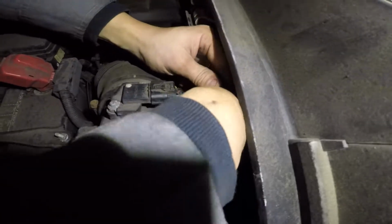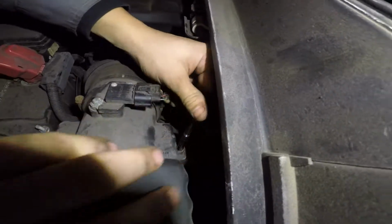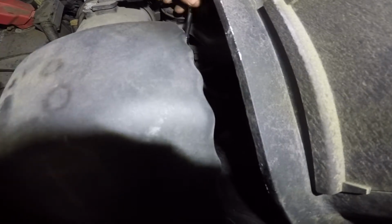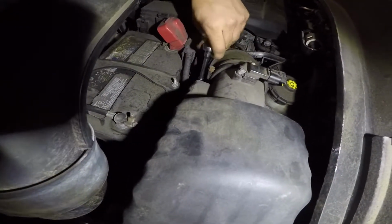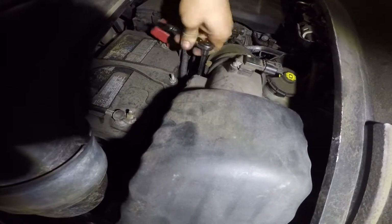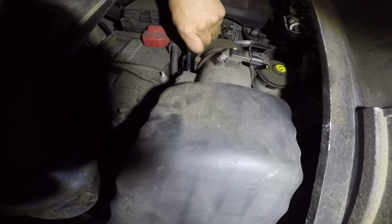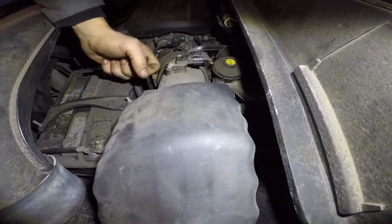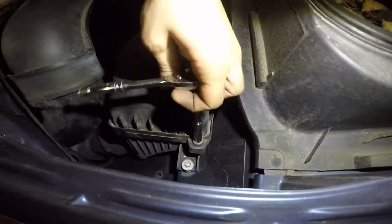And there's one over there. So what he's doing is he's catching the threads on each bolt. Once he catches them all 4, he's gonna tighten it up, and that should lock the housing down with the filter inside. 4 in there, and now he's gonna tighten them up. What I like to do is go over there, crisscross, so the filter housing sits flush.